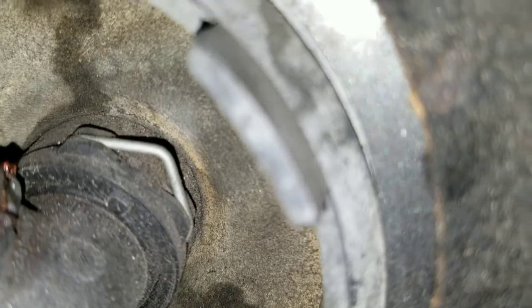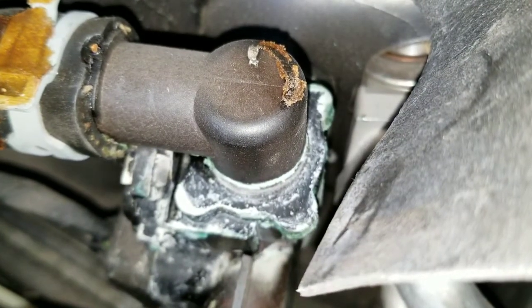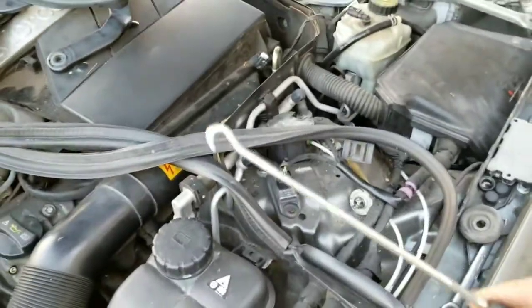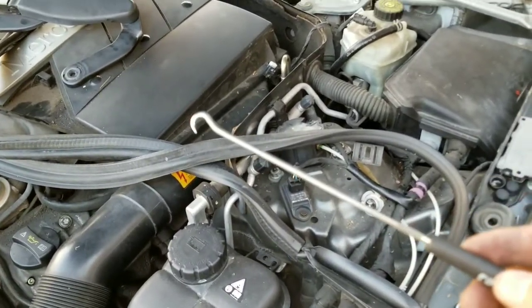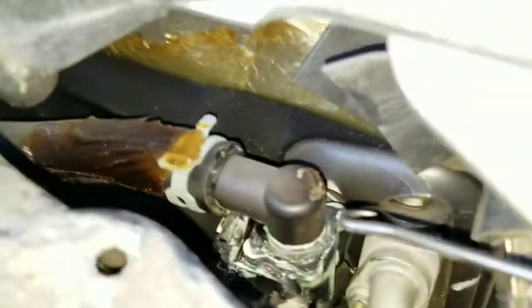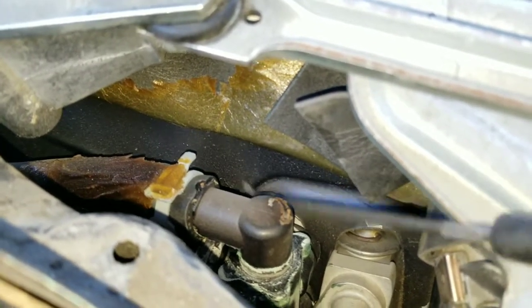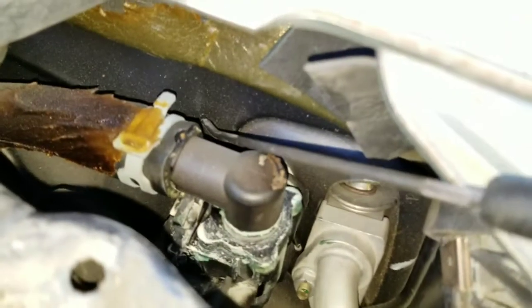And then as you can see at the back, we're gonna pull that clip. And then there's one right here in the front. That clip right there, we remove that, pull it up, pull it out. And then I think it might have another one at the bottom too. So we're gonna go for it. All right, guys, hold on. You're gonna need, either you can do your own hanger, cut a hanger, do like a loop, because it is really, really tight in there to get to this one right here. Pull that clip out, that clip down there, and there's one underneath after this clamp. There's two, one here and one underneath there, way down there.